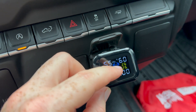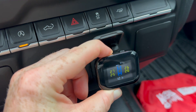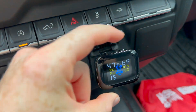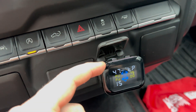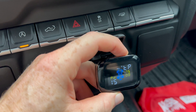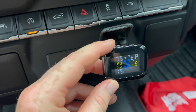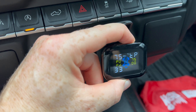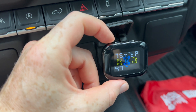There are some settings you'll want to configure. To change between PSI and bar, or Celsius and Fahrenheit, do a long press on the set button. From there you can switch units. Press the plus button to toggle between Fahrenheit and Celsius. Then you set the high pressure threshold — for my RV it's much higher than a car, so I'm setting it around 70 PSI. Then set the low pressure alarm; 15 is too low for my case, so I'll set it around 46 since my tires are currently at 50-60 PSI.